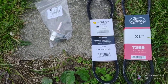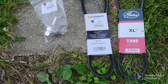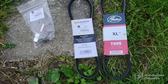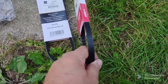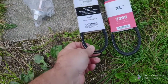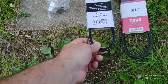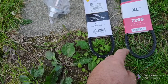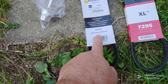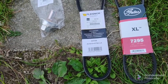Hello everyone, it's June 8th, about 7:30-8 p.m. Last week I was going to change my air injection reactor pump belt — it's getting kind of old. I ordered this one and it seemed too thick. The width seemed too thick, so I ordered this one, which is the part number everybody seems to use, and it's also much thicker than the belt I have on there. This is a 10 millimeter and this is a 10 millimeter, but the one I have on there is a 9 millimeter.